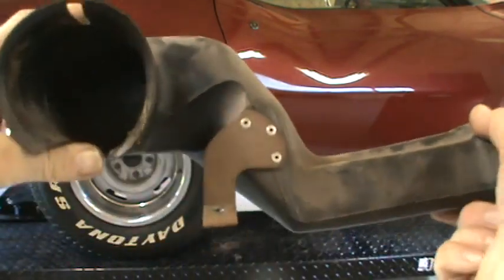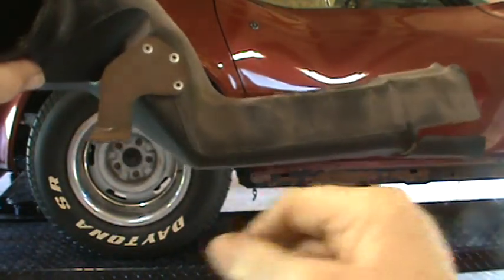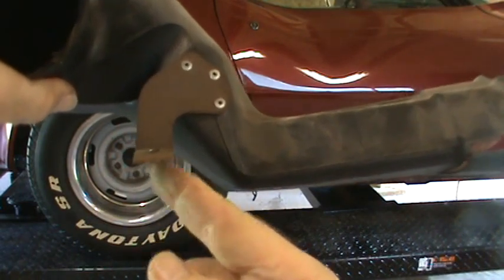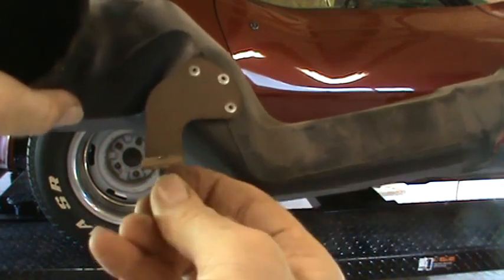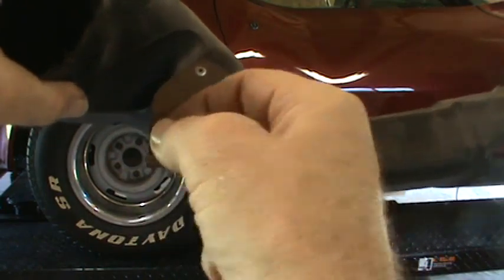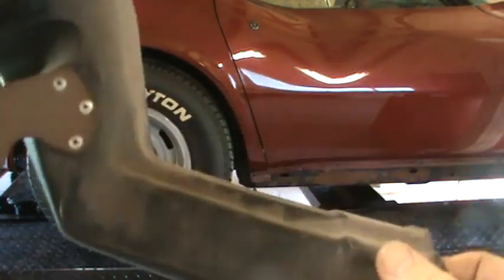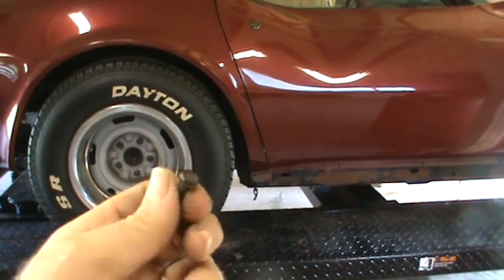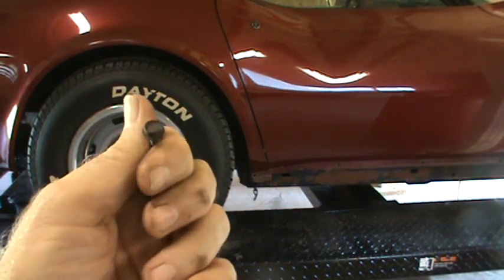For the air conditioning vent — this is the vent right next to the trip meter reset near the firewall. There's a little bracket, looks like a quarter-inch screw held it on. Once I took that screw out I was able to shift it over, take it off one end, drop it down, and push it back out — piece of cake. It's actually a five-sixteenths screw holding the air conditioning vent in.